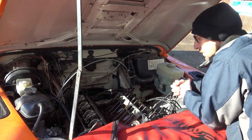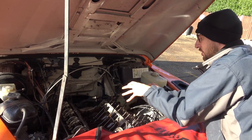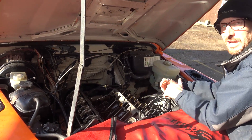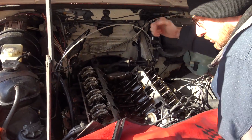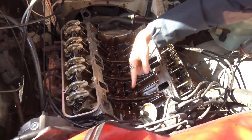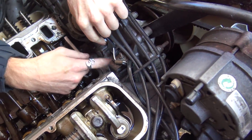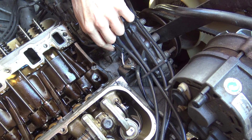Getting a camshaft in there would be a good idea, probably in the next 10,000 miles or so. However, we discussed this with the customer and the customer doesn't have the budget for that at the moment. We're perfectly happy to put this back together - there's nothing in here that's of detrimental value to reliability. Holly's already drilled out the hole on the rear of the timing cover for the water pump. With the Weber conversion, we now use both of those ports - one of them was blanked off before.